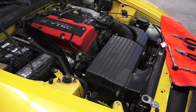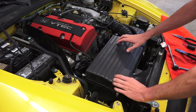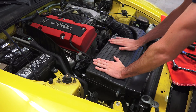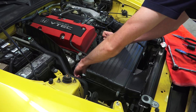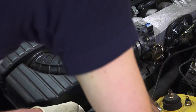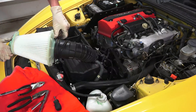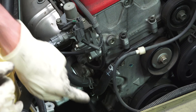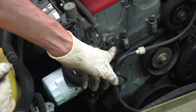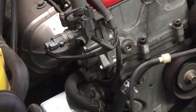The first thing we're going to do is get this air filter box out of the way. This isn't really necessary unless you're installing the OEM tensioner, because there's an access port right here to remove the pin on the OEM tensioner. I'm removing it so we can get a better view. To remove the airbox, there are three bolts — two on the left side and one on the right — plus any hoses and electrical connections to detach. Now we have a great view of our timing chain tensioner right here, along with the maintenance port. If you install the OEM style, you'll unscrew this port and pull the pin out through this hole.